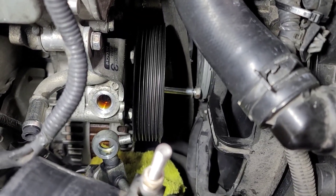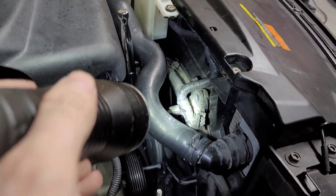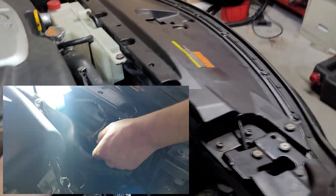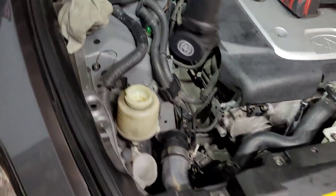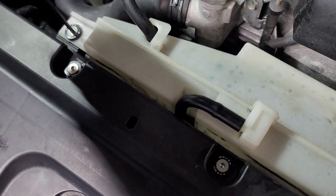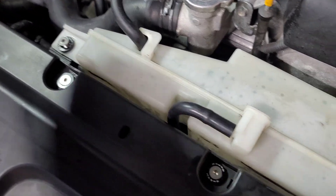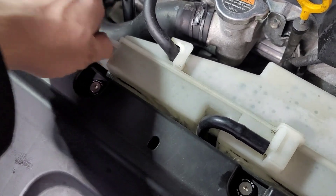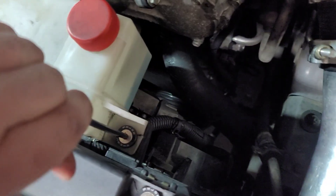He's jacking up the car — it looks like we're going to have to remove these 10 millimeter bolts holding on the fan shroud. There's one on the top right corner and another on the top left. We're also trying to get access to the bottom of the car to see what else is holding the shroud. Once you get the coolant reservoir out of the way, you can push the fan shroud down. This car has quick-disconnect style Allen bolts that I'm loosening up with an Allen wrench.